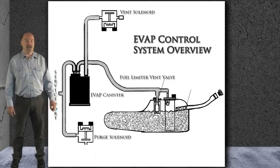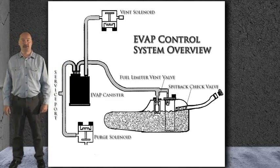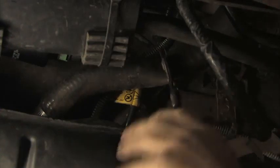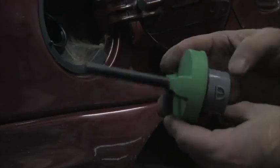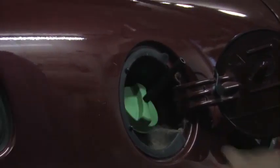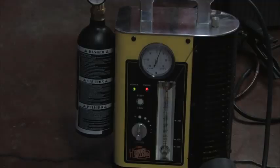This system also has a spit back valve in the filler neck, which prevents kickback during refueling. We decided to pinch the hose off from the filler neck and feed the smoke from the cap area using a handy adapter. Look at the position of the leak detection ball now — we definitely have a leak associated with this filler neck. Using a laser, it's obvious we have a leak around the cap area.